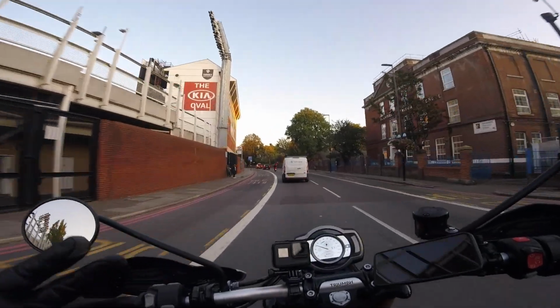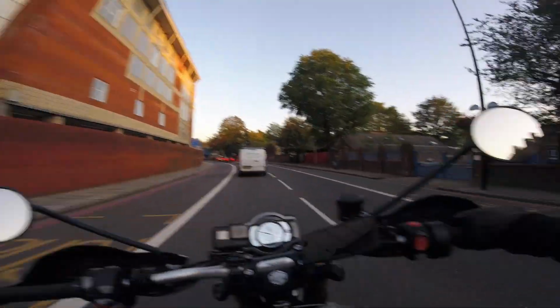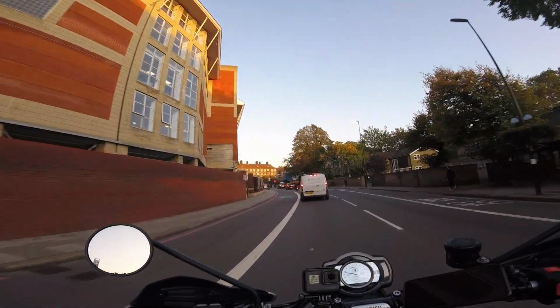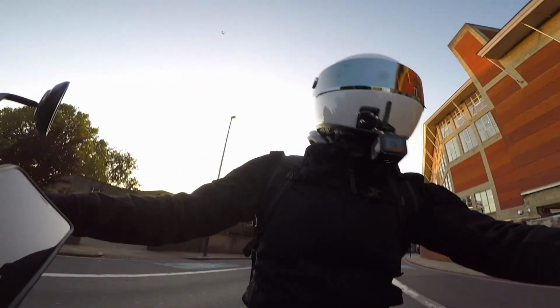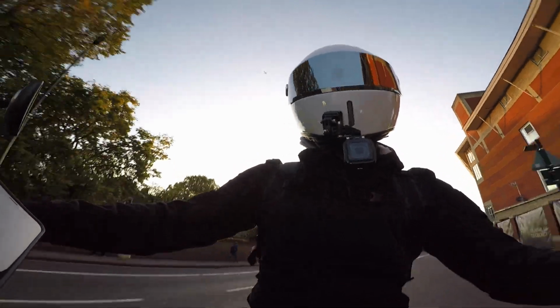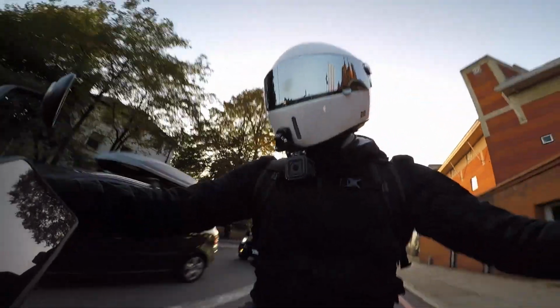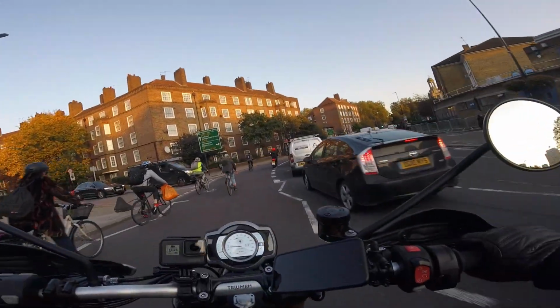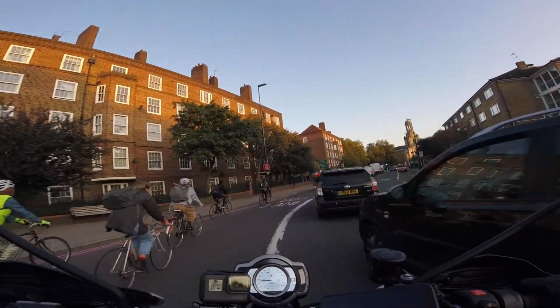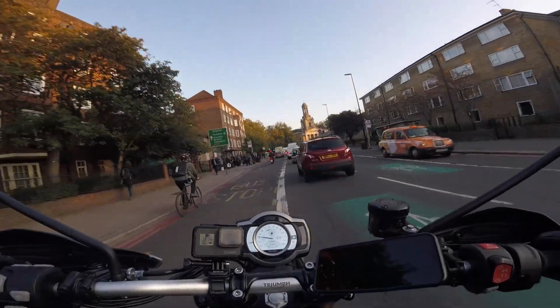It doesn't have sharp initial bite, and I've come to the conclusion that pretty much across all Triumphs, these modern classics anyway, they don't really have a very sharp sports bike type bite to them. This has got a Brembo master cylinder and the Brembo calipers as well, the M50s. So I don't think it's a hardware thing, I think it's by design.